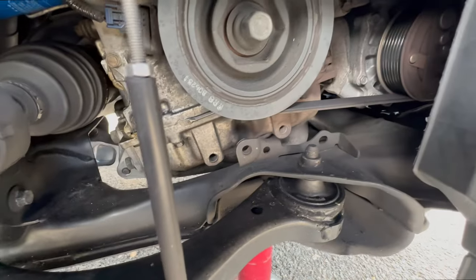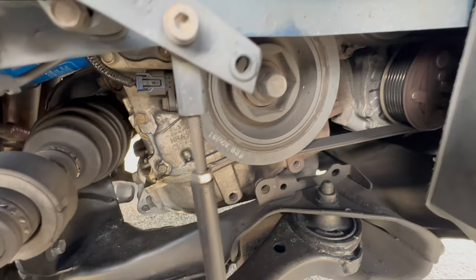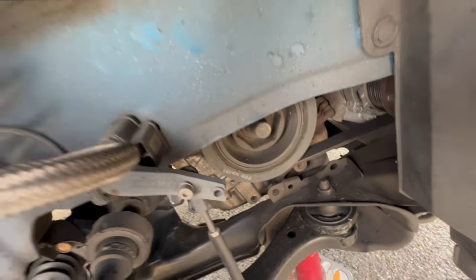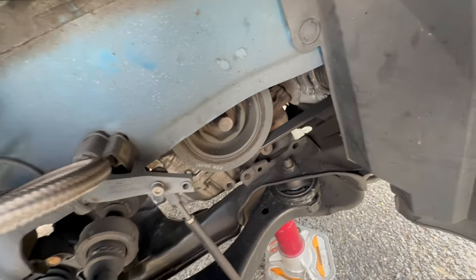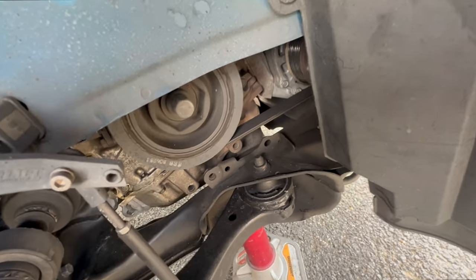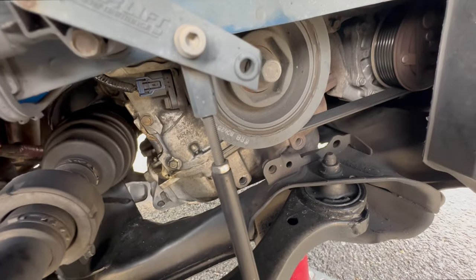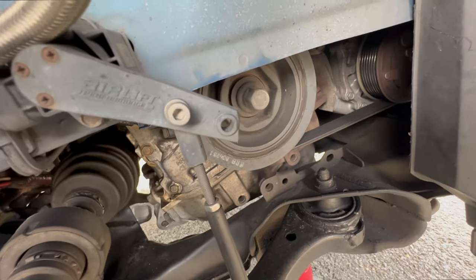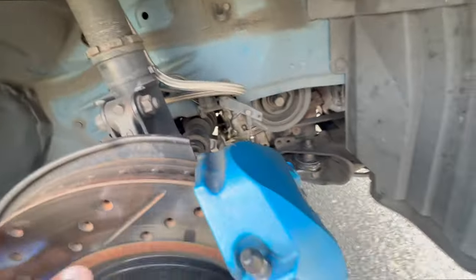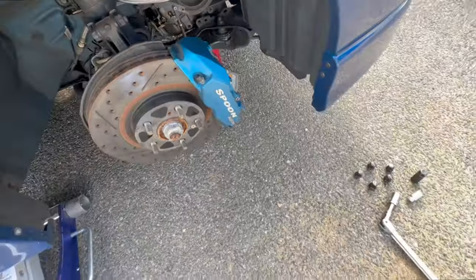Yep, gotta do the oil pan. You guys can see I do have a small leak right there, but as you guys know, the subframe has to drop again to even do the oil pan. When I was doing the clutch on this car, which I didn't make a video of, Miguel was helping me out, my friend. He has the FA5 that's turbo, making 500 horsepower, but he sold the whole car, or kept the motor from the car, and he's doing an all-wheel drive hatch right now. But yeah, when we pulled the subframe, he was like, hey, I see your thing's leaking, did you use Honda Bond? Nope. I'm like, damn. It's like, yeah, we could have resealed it. And I was pissed, because taking a subframe out is a pain in the butt for sure, especially doing the clutch.